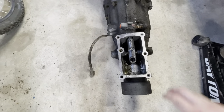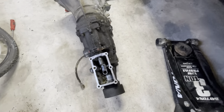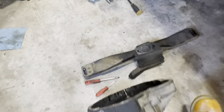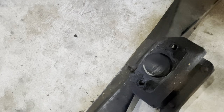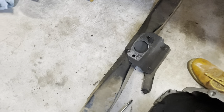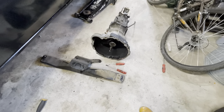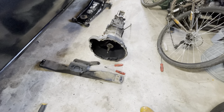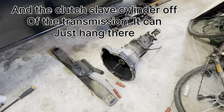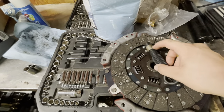Inside the truck the shifter boot and the entire shifter has to come off. The engine mount bolts — the ones you access from underneath, plus the corner ones when you're ready to start dropping. We took the starter out. Then obviously the bell housing bolts, and transmission comes out. I also spent some time and got the old pilot bushing out so the new one can go in.